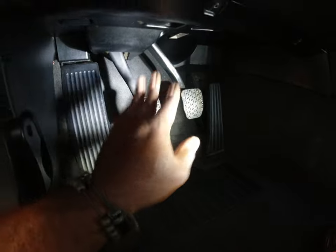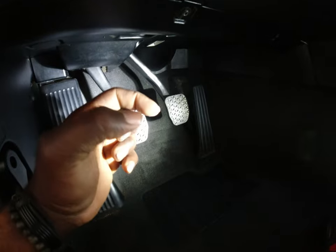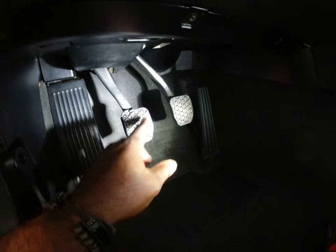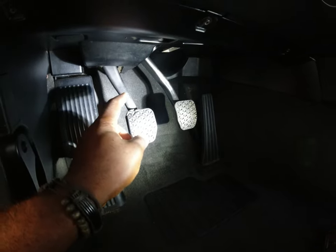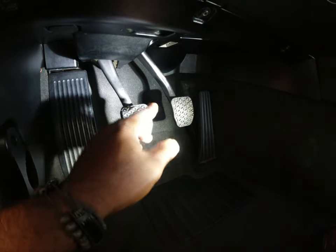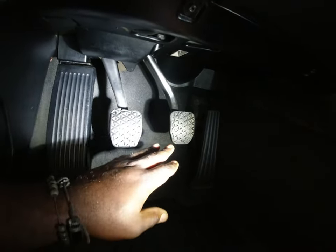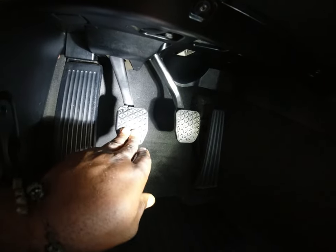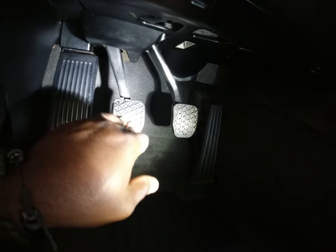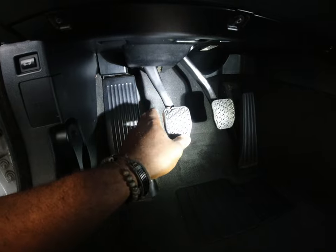Another issue I had — this may or may not fix it, but I'm open to it — is that there's a lot of travel with this pedal. A lot of guys mention putting in little bump stops, but in this case there's already one installed and it's still a lot of play all the way out and high up. Also, the clutch pedal is actually higher than the brake pedal, so the new pedal should have them more aligned. I'm really curious how this might turn out.